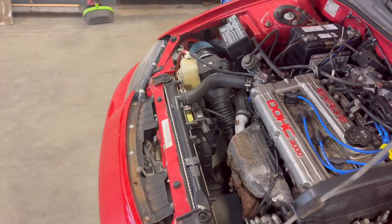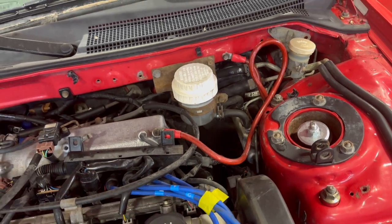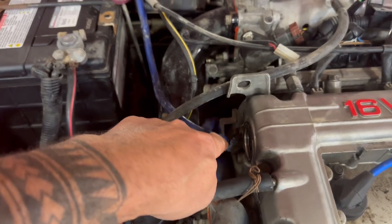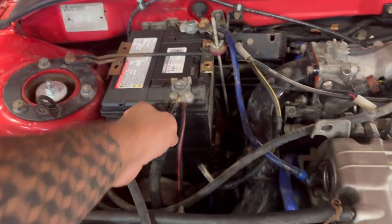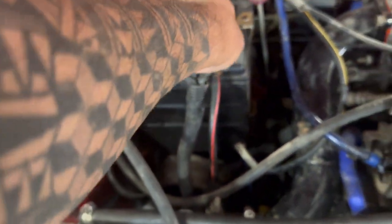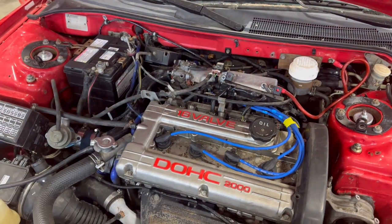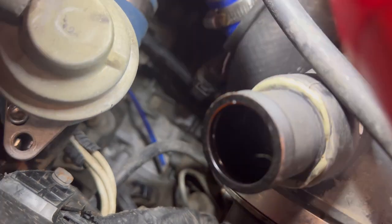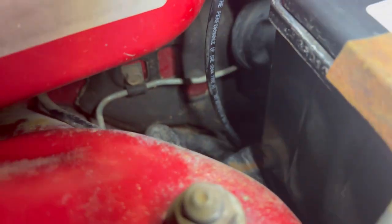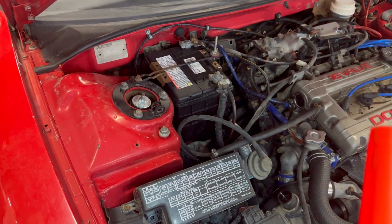Let's see what we're looking at with the firewall. As suspected, everything is tight. I got excited thinking it was already wired for a sub, but somebody just used a really long red wire for a ground for some reason. Over here there's a blue wire that's a shitty ground of some sort. Some people... I don't know. If I built that, the car wouldn't even run. It keeps getting worse. We're going to see if we can find a hole in the firewall, get the wire through there, then work on wiring the sub in. I found a blue speaker wire that actually goes back through the firewall — I'm going to tie the 8-gauge amp wire to it and pull it through, since that blue wire isn't doing anything anymore.